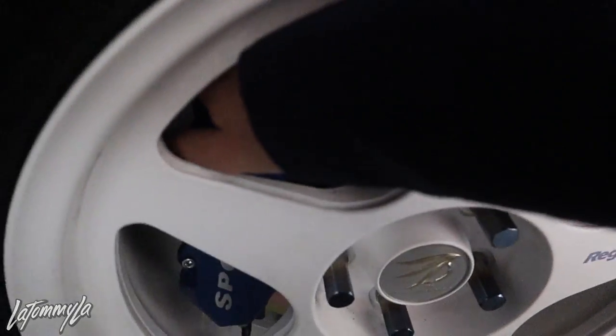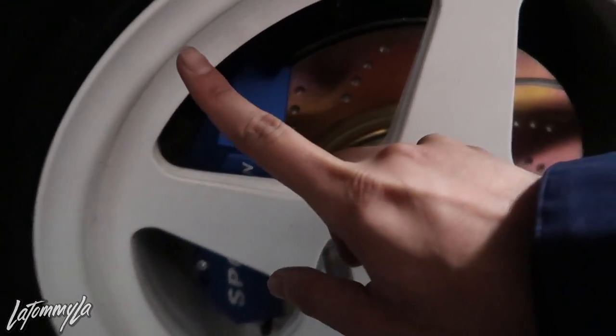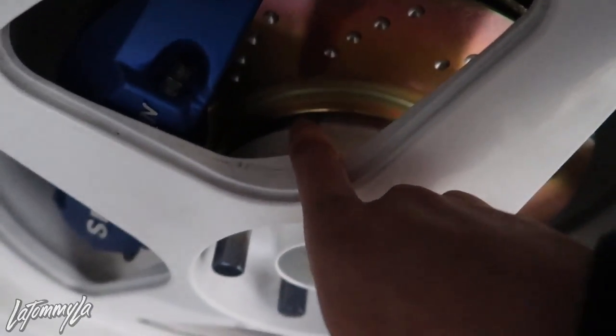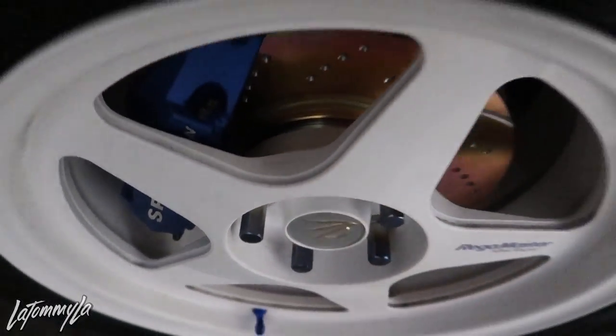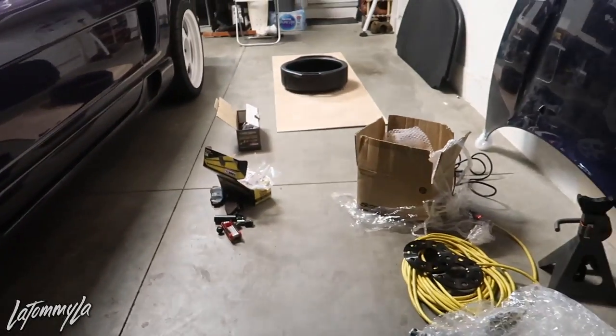Did you tell them what happened? No. Well, Sean doesn't have tools, and we should have done it at my house because I have tools. So we're trying to drill out the rotor screw. We need to tighten down the caliper. Well, it's bolted down, it's not going to move anywhere. But we need to tighten down the top hex ones, and they're way too big. And Sean doesn't have any damn tools. So we need hex keys to take this off so we can put the brake pads on. This literally has no brake pads on it. And he has to run a 5mm spacer. Well, this is 6mm, so he could clear the wheels. And he doesn't have spacers because he bought these ones, but they're not hub-centric. So his car's stranded. Oh, dude, they just scraped? Holy crap. Now we gotta go to AutoZone to pick up tools.